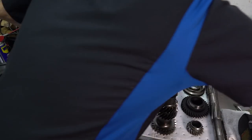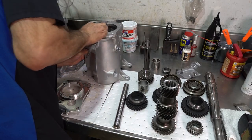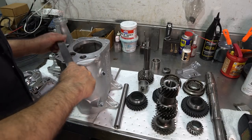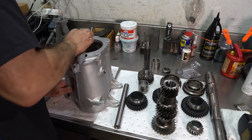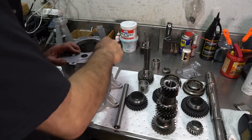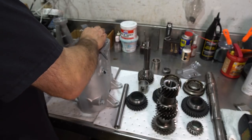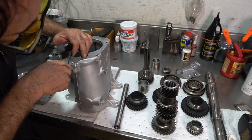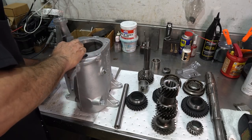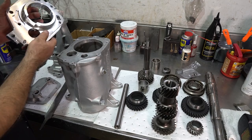This case was already gone over, but I'll take a file and go over everything — just making sure all the surfaces are flat, taking away all the high spots, and visually checking for dings or dents. Most of these cases are pretty beat up; they've been rolled around, bounced around. The reason I like doing this is because if I can start off with really flat surfaces, everything is going to line up really well.